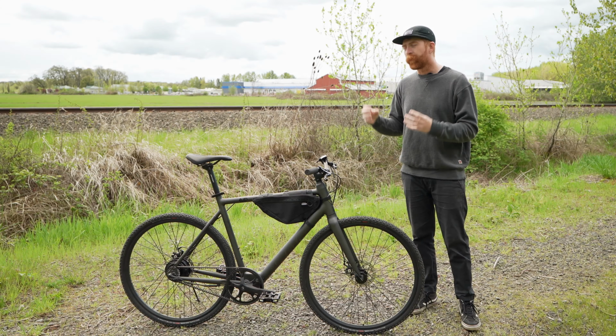We spent a lot of time on those calipers and where they mount to make sure everything was level and really even, to make sure that we're having even, good, quality, consistent braking power. I know some people knock on mechanical disc brakes and say hydraulics are better, and I'm sure there's benefits, absolutely. I do like hydraulic, but if you have mechanical, spending the time to make them work the best is always worthwhile and lets you know your bike more.